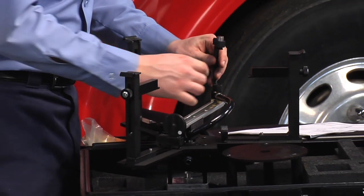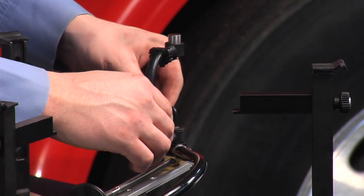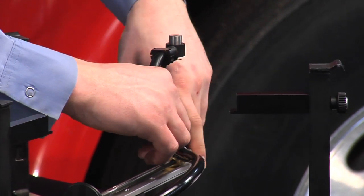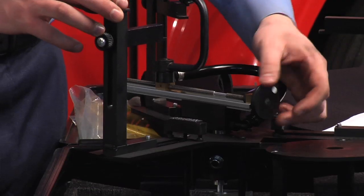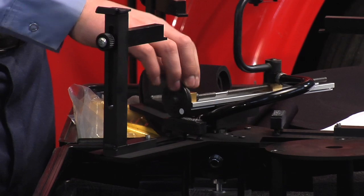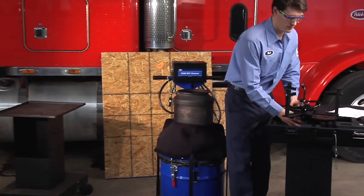Install the flange nozzle onto the nozzle arm using the supplied mounting nut. Install with the bent part of the nozzle parallel to the nozzle arm and pointing toward the center of the unit. Tighten the nut with a supplied hex key wrench. Manually rotate the drive disc to ensure the swing of the nozzle clears the feet.